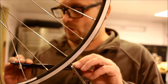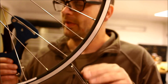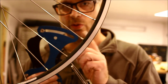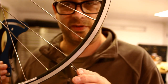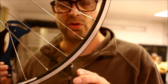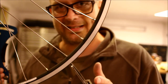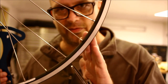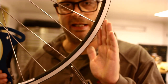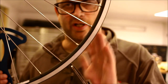That's it. I bid you good luck in your wheel building. I'll also post a video on just the tension meter tool, and I've already posted a video on lacing up a wheel. Those three videos together should cover the highlights. Quickly to review: hub adjustment — fundamentally important. Use a screwdriver or nipple driver to drive everything up to roughly the same place. Adjust for dish.